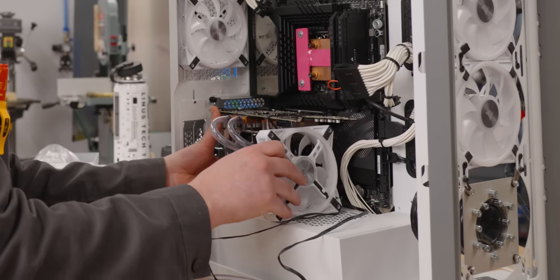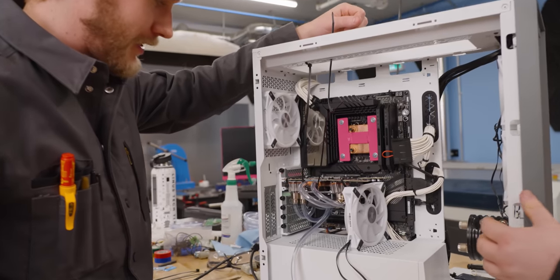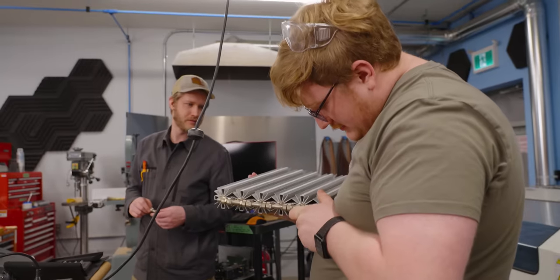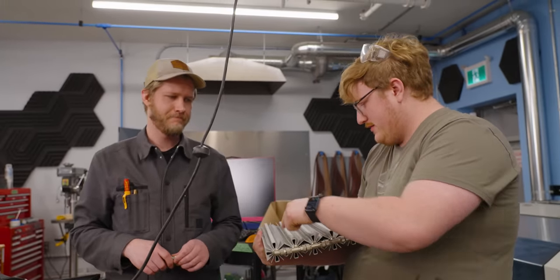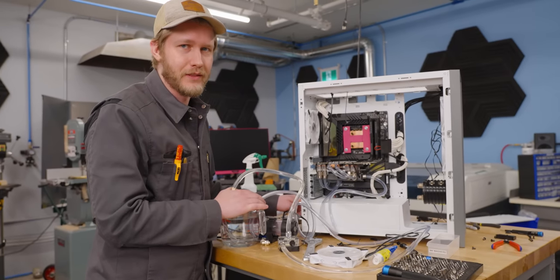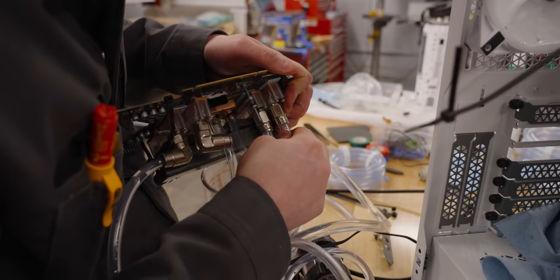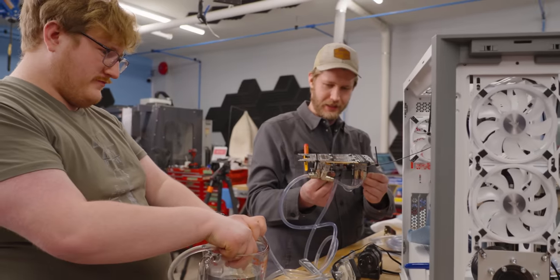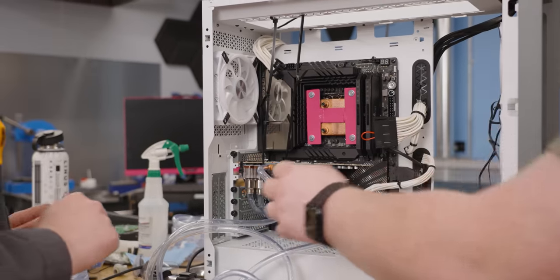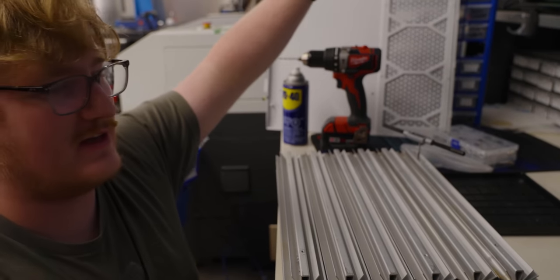Let's chuck her in. There's not a single problem with mounting a GPU like that. It'll even hold the tubes in. There are some screw holes — if I just drilled them and threaded them, I could actually screw this right into the back panel. What do you think the chances are that this thing just leaks terribly David? Zero — this is airtight. Oh god, it's leaking! Just a little bit too tight of a bend. It does appear we have no more leaks in our GPU. Drilled some holes in the side panel, drilled some holes in this thing, now I'm just tapping them. Theoretically once this is done you just line this up with the side and run some screws and that holds it up. Look, I even put spacers that I found in the drawer.